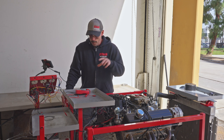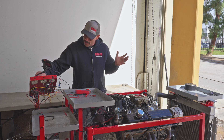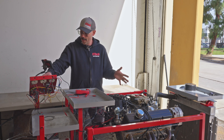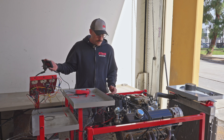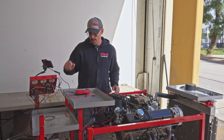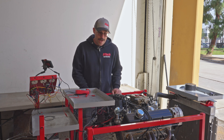With this system, we've got power going directly to the battery and a TAC signal now. Let's show the next situation you may run into. We key on — fuel pump prime, prime shot from the injectors. We crank. The system, for some reason, just went through the prime sequence again when I released the crank. I also noticed that there is still no TAC signal. We know we have our TAC lead hooked up, so we need to look into why that would happen.